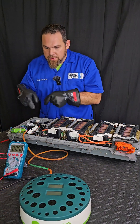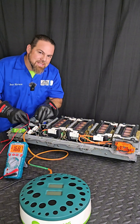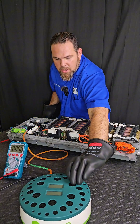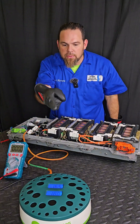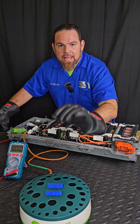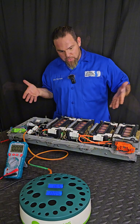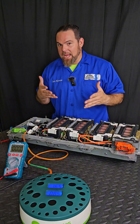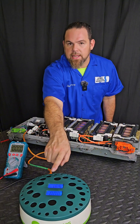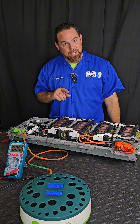The circuit is now closed. Measuring main positive to main negative: 168 volts — now I can start the charger. There it is — we are injecting 250 volts at a very small current in pulses. This process must be performed by a professionally trained technician, because you are dealing with life-threatening high voltage. I'll be monitoring over the next few hours, tracking how much power is being injected until we reach at least 210 volts.